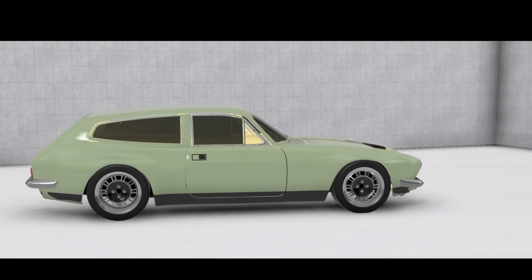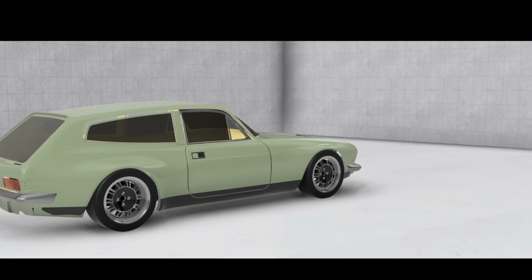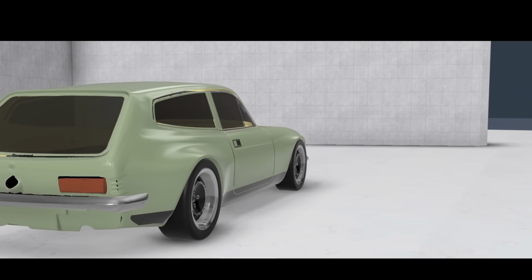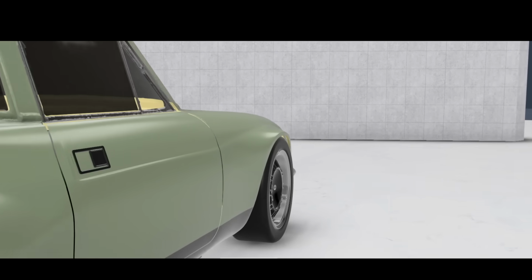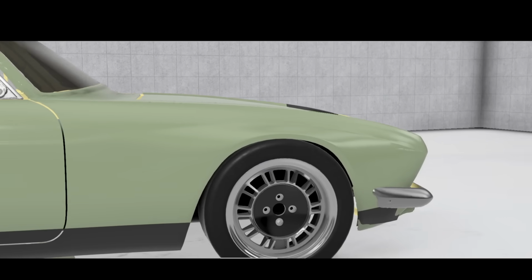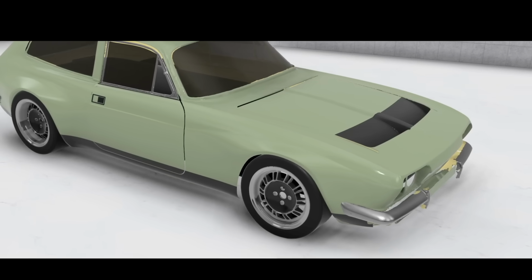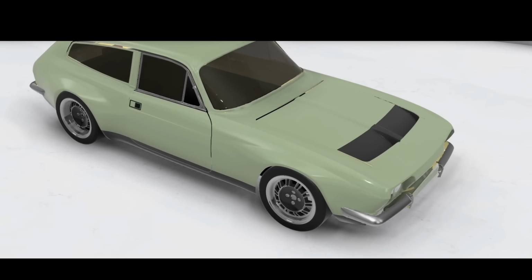We were going to bring it down the side of the car right from the front, over the front arch, because we thought we could manage that, and then basically end it where the door handle is. So then there is no style line behind that, and so you don't have to work out how that behaves with the big swelled out rear arch on it. But we're really struggling with the style line ending up too high if you leave yourself enough land to transition the width of the front arch below it. So we were just having a quick chat an hour ago about maybe introducing a vent behind the front wheel, not having the style line over the front arch at all, and then having a style line appear from the top edge of the vent behind the front wheel, going all the way down the side of the door and ending at the door handle. Then it will remain to be seen whether that looks worthwhile or not.